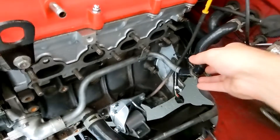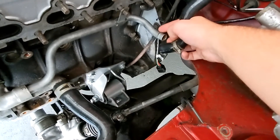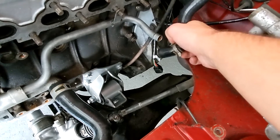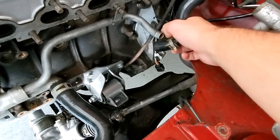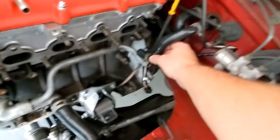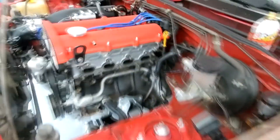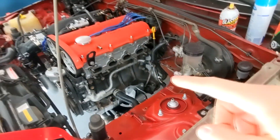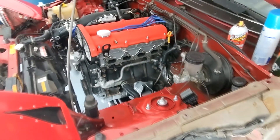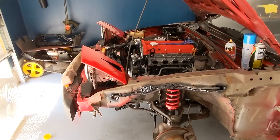In the meantime, I noticed when I was test-fitting stuff that this heater core line was really close to the downpipe elbow, so I went ahead and cut it off. It used to have two ridges on it — one for the seal, the other to stop the tube from going in too far. I cut in the middle of them and trimmed it down, so the tube should sit more like this instead of being kicked way over. That should help with clearance. After we drill and tap the pan and put the fitting on, that's basically the last thing, and then we can literally just bolt everything else up.